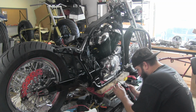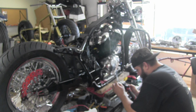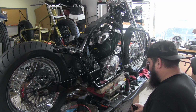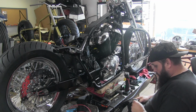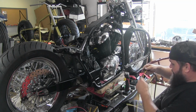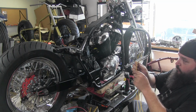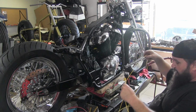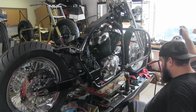That's for two reasons. One, if you're working by yourself, you would really need three hands. Okay, so back to what I was saying about tinning the wire. You get the wire preloaded with some solder, because when you're working by yourself, if you don't do that, you need three hands. One to hold the roll of solder, one to hold the wire, and one to hold the soldering iron. So, for obvious reasons, that isn't going to work.